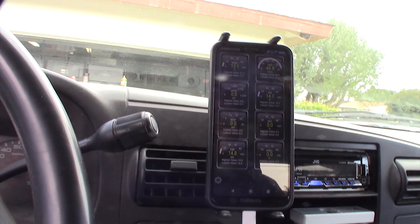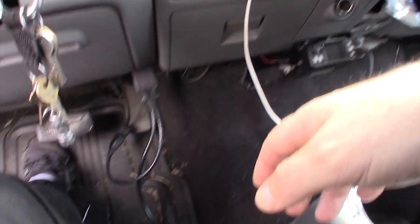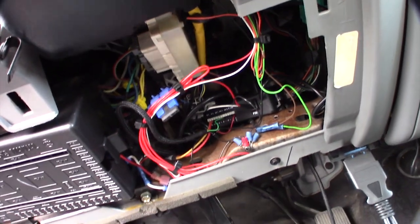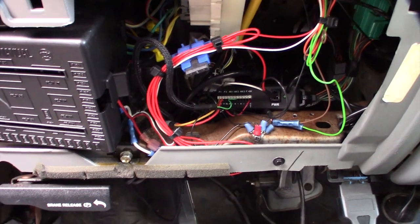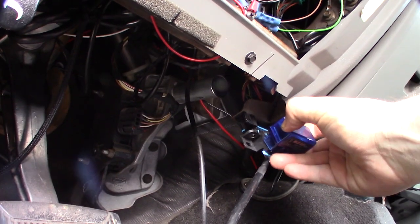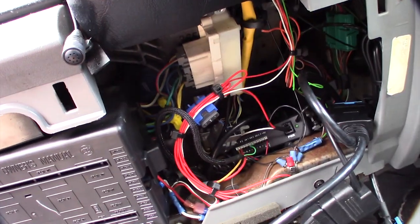So I can actually have more insight while keeping my tuner on there. Now that I know it works, I'll put the wires together. I'm going to pull the dash panel down — that's the BullyDog GT right there. I'm going to try to unscrew this and fish it back up through the dash. It looks like a couple of screws. The splitter is going to take the place of the existing OBD2 port, so it looks factory.